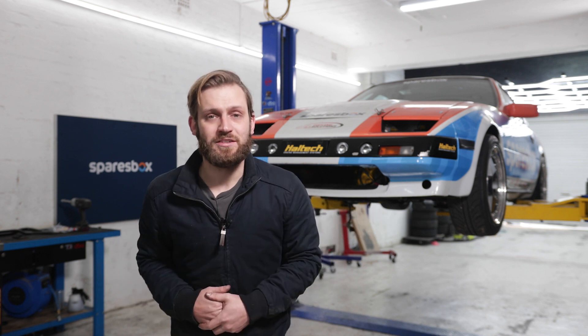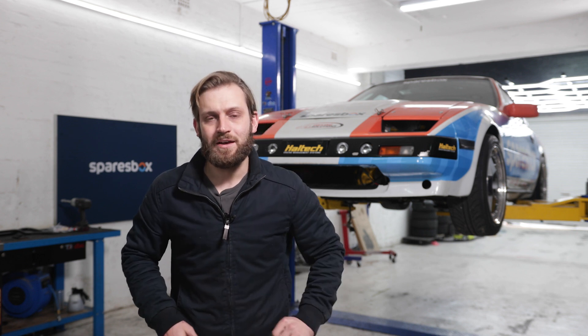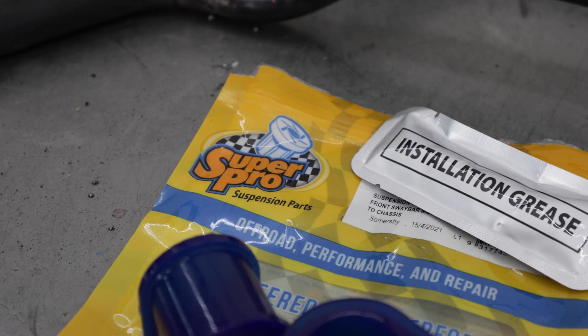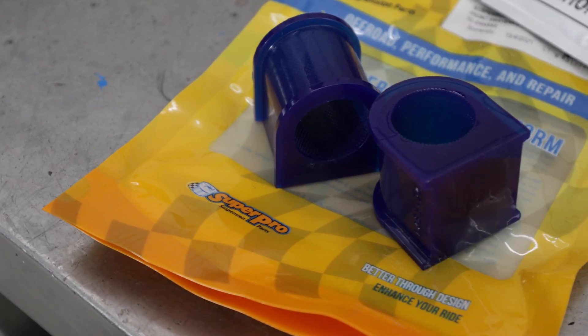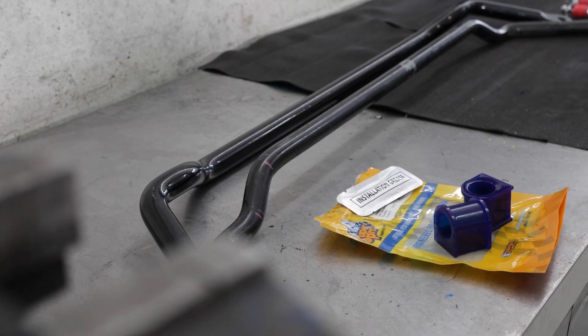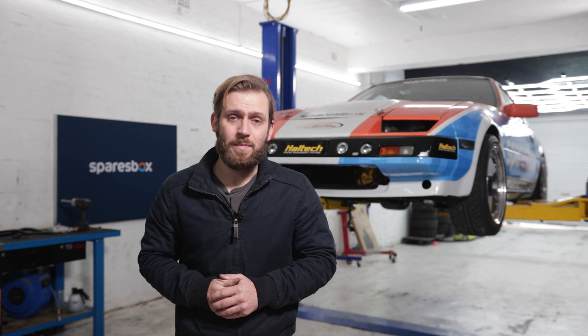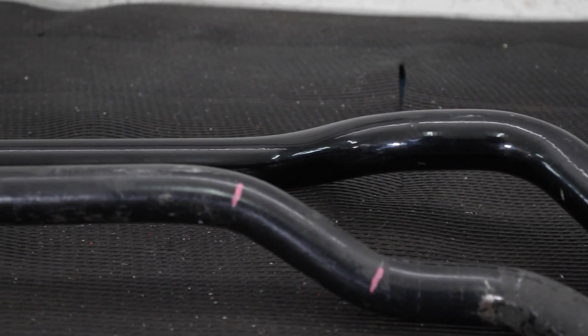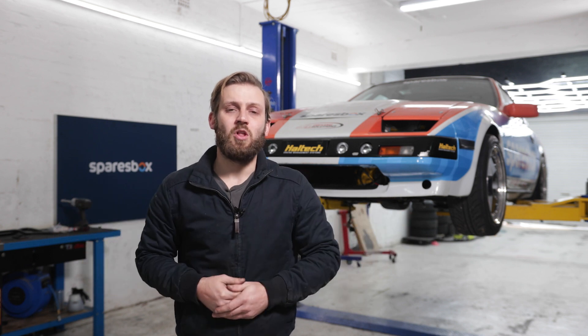Having a car like this, which is largely untested, having that ability to play with the car's dynamics is awesome. Fulcrum Suspension are able to make up custom sway bars to a sample or two measurements, including bushings, which is exactly what we had done for our Z31. We have S14 lower control arms in this car and the sway bar links didn't quite line up with the factory Z31 sway bar. So we had Fulcrum Suspension bend us up a 26mm sway bar for the front, and we had them move the mounting points 32mm inwards so it lines up perfectly with our sway bar links on our lower control arms.